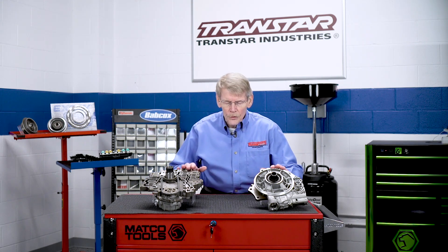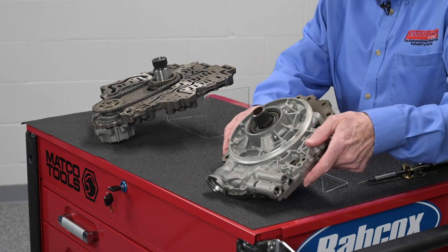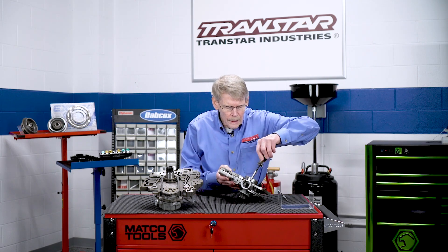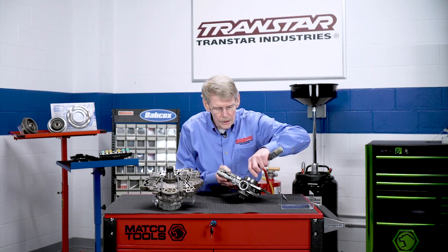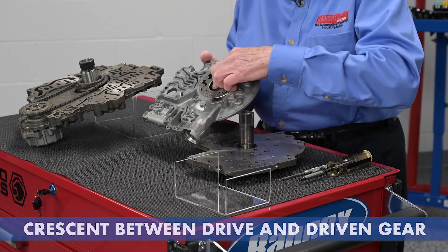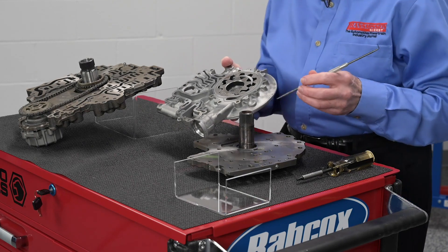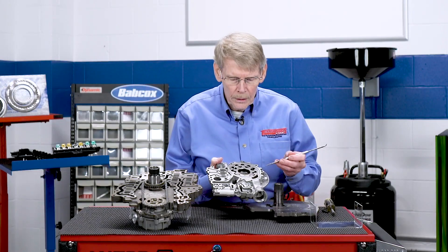What we have here are two different designs. The one on my left is actually the Gen 1 and Gen 2 pump, and it's comparable to a lot of earlier transmissions. On this particular pump, there are a lot of different torx head screws you have to remove. The Gen 1 and Gen 2 is basically a gear type pump. It has a crescent between the drive and driven gear. They have not had a lot of issues with wear on these pumps. There have been some design issues between Gen 1 and Gen 2 relating to the regulator valve and a little bit of capacity.